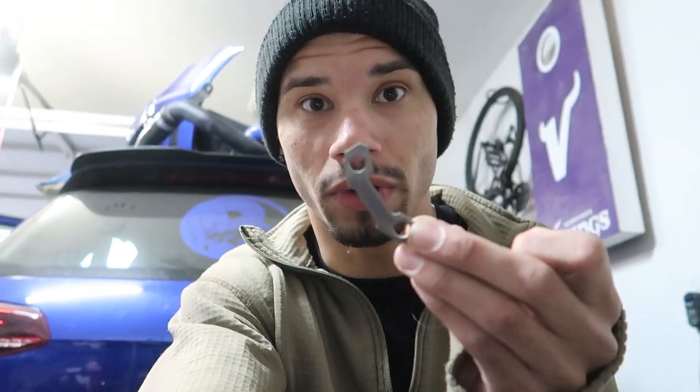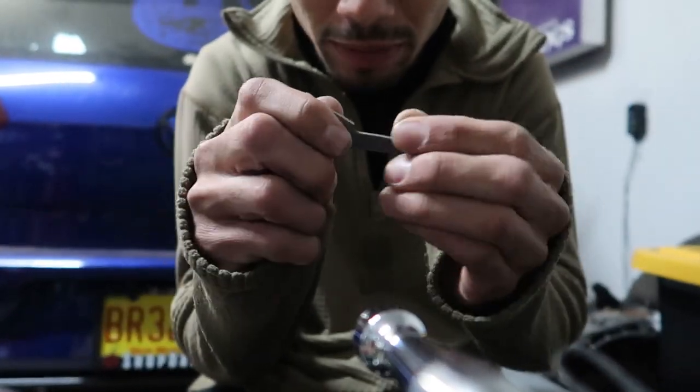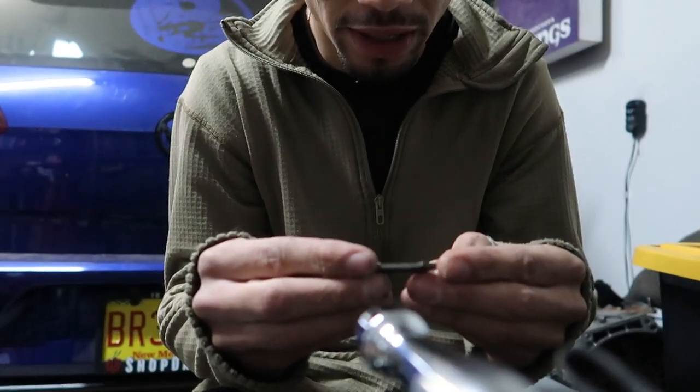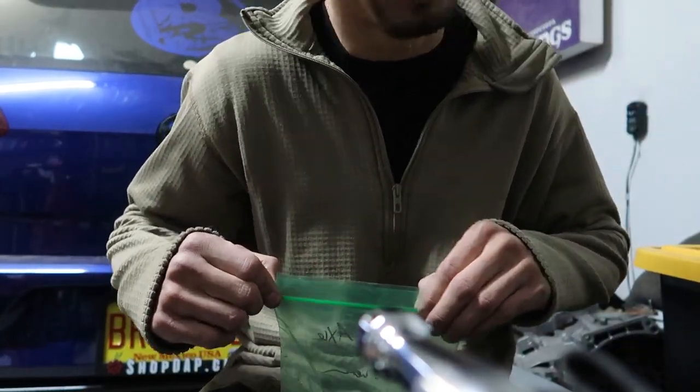When you do so many things on the car at a time you forget to do things you probably should. Can some of you guys tell me what the function of these are? These are caps for the axle bolts - on the rear axles I forgot to put these on. They're torqued down pretty hard, so obviously I can take them off, but I'm gonna have to order new bolts because they're one-time-use torque-to-yield. I just want to ask - what do these do exactly? Do they squeeze together to keep tension on the bolts so they won't back out? I did loctite all of them.